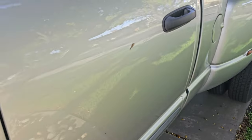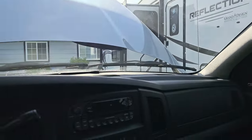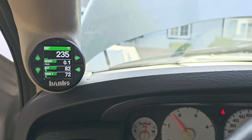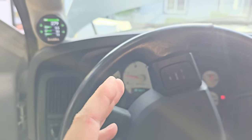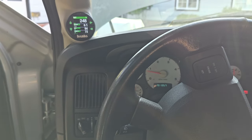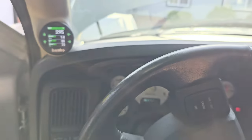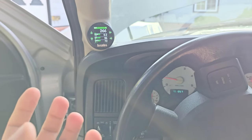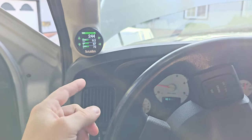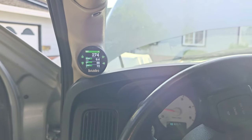I decided to go with a non-wastegated configuration because, being that we have a larger turbine wheel, it really won't probably make more than about 38 pounds un-wastegated. You can hear an inherent lag — that's because normally a wastegate would be opening up and throwing away exhaust energy. That delay is because the engine is still consuming all the air the turbo has taken from the exhaust, spun up, and forced in. That's why it's doing a rev hang sort of thing, which is totally normal with a non-wastegated turbo setup.